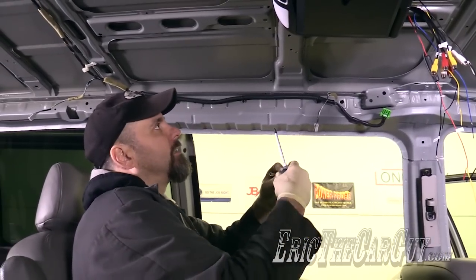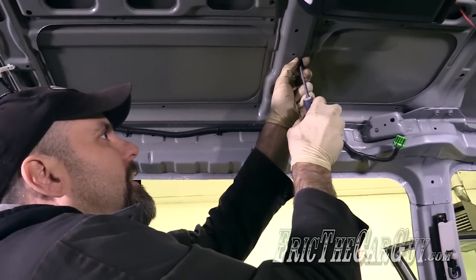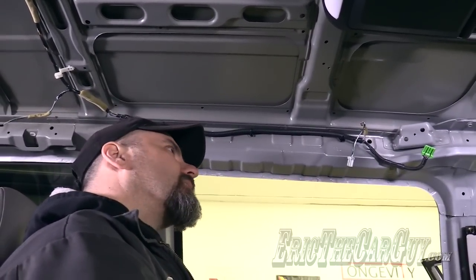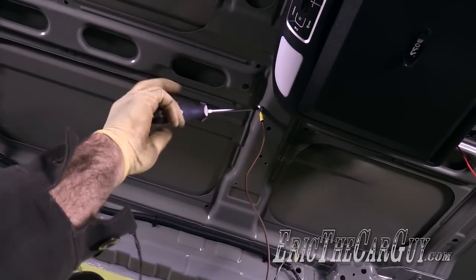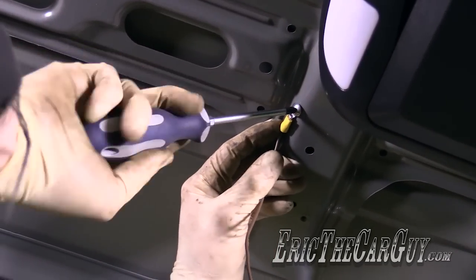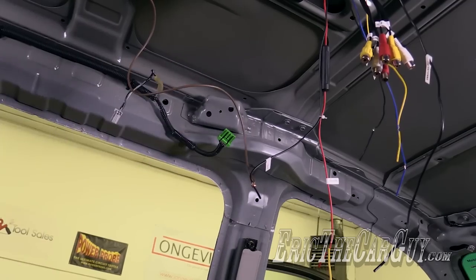The ground wire could be fairly easy - I could just use one of my mounting screws as a connection. I was going to run it to the mounting brackets but I've decided against that. I've drilled a hole and I'm going to add a ground there. Grounds can be found just about anywhere on the body - the best grounds go to the frame and the battery itself, but you don't always have that option. Got ourselves a good ground. I'm going to leave myself a little extra wire and test it out before I actually commit.